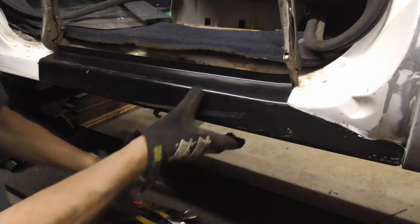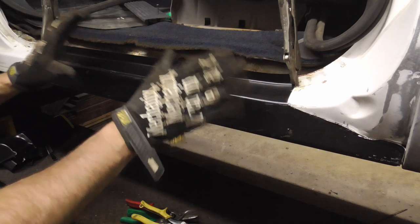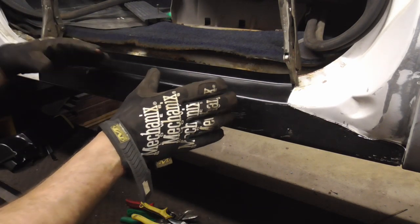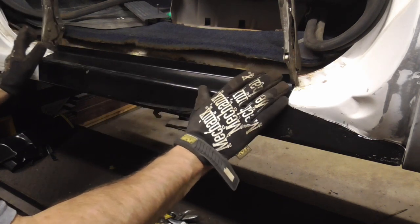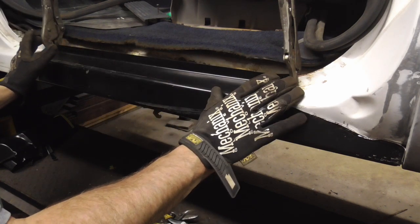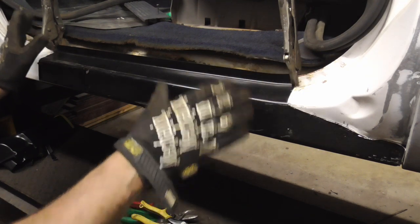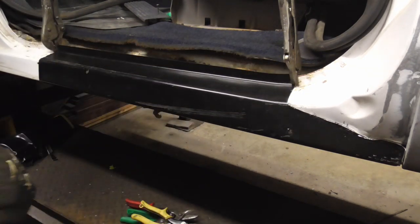After having a little bit of patience and just cutting off a little at a time with some good quality tin snips, your panel should be butted up there ready to be welded into place. I hope you enjoyed this video on how to go about measuring and cutting a patch panel to fit almost perfectly. If you did, don't forget to hit the subscribe button.